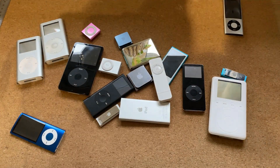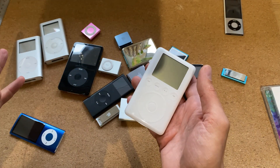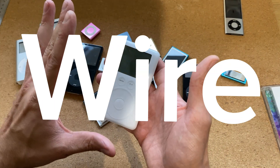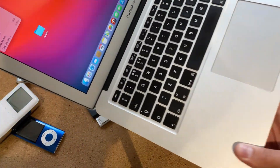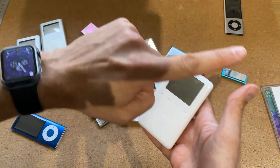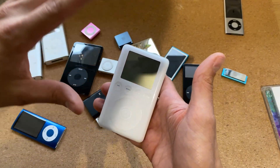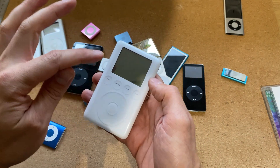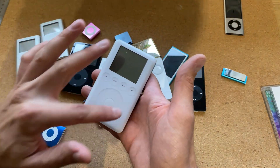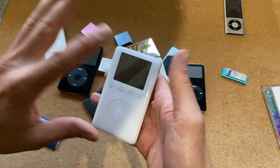The other issue is that I have a third gen Classic, and I want to add to my iPod collection — hopefully get a first gen and a second gen Classic. These are all Firewire. The problem with Firewire is that most laptops, this one included, do not have a Firewire port. You can sync this to that laptop via a USB to 30-pin connector, but the problem is it will not charge the device while it is syncing. The battery is getting older, there's a mechanical hard drive, so when you're syncing it the hard drive is spinning away and the battery is slowly dying. It can die while you are syncing, which means it will corrupt and it'll be a bugger to put right.